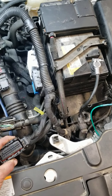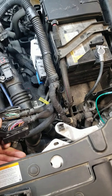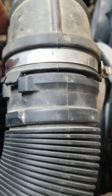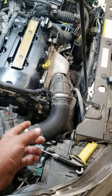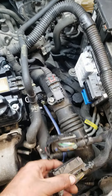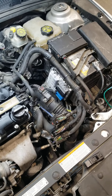This connector has no oil pressure, no nothing like that. The only kind of fluid-type pressure sensors or stuff like that is the thermostat heater, which is electric on this car. I pulled the thermostat electric plug and this connector is just full of coolant. It's called wicking — basically the coolant pressure was coming through the heater and going through the casing of the wire all the way back to the connector and pushing coolant into the plug that goes into the PCM, then jumping signals between two different things.